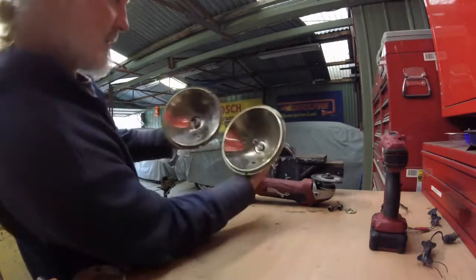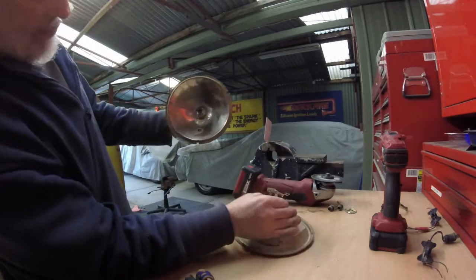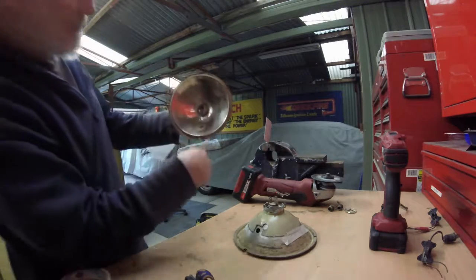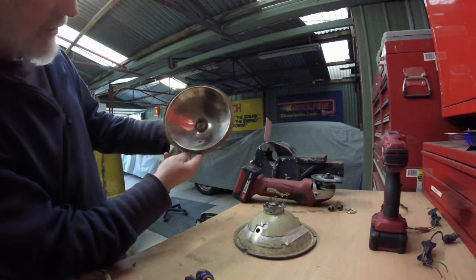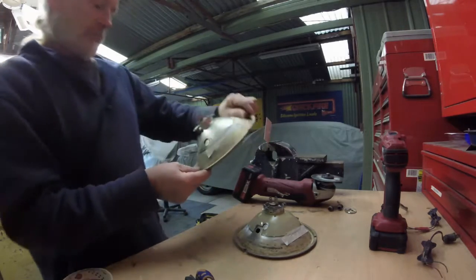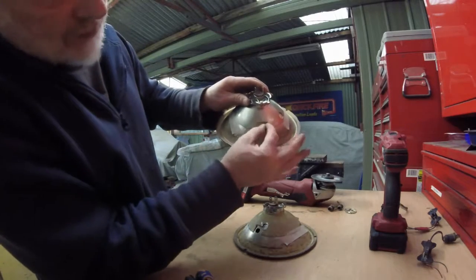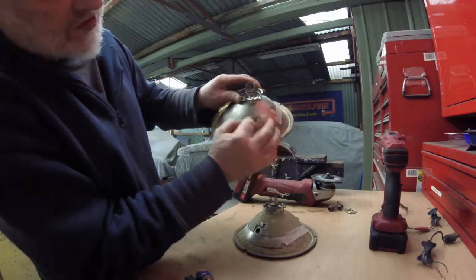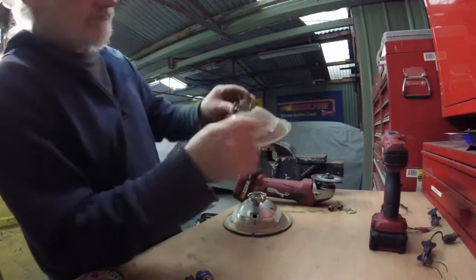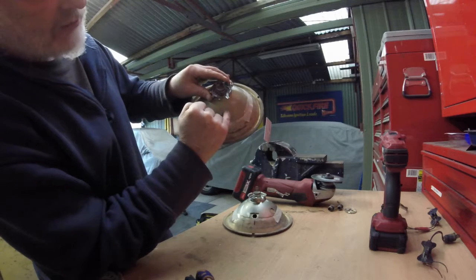Got these mounted all correct — they usually say the flat surface of the halogen globe always goes to the bottom, so that's what I've done. On the back there I've had to cut a little piece out just to put the parking globe in so I've got clearance around that. This one took a little bit of work because the parking globe on that original rectangular headlight was in a different position — it was offset to the side — so unfortunately I had to bite into it a little bit.